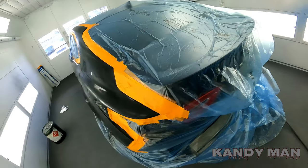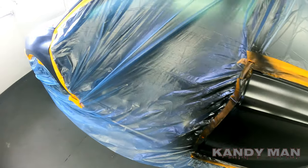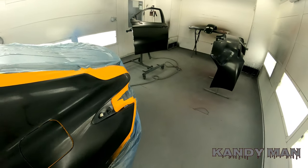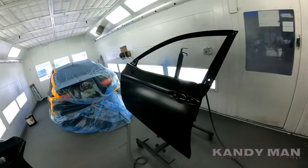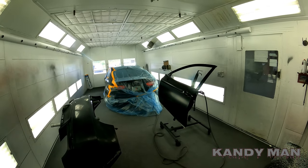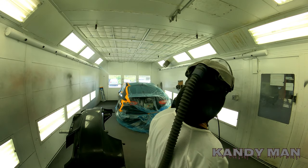Here's the car in the booth with the sealer on it. This is Toyota Attitude Black 218 — it's got some metallic and pearl in it, but I sealed it with a black sealer. We did the side of this car, put a new door on it, repaired the door and the quarter, and a little repair on the bumper. With this gun I'm only going to put one coat of base on and then a drop coat, because this color covers so well over the black sealer.